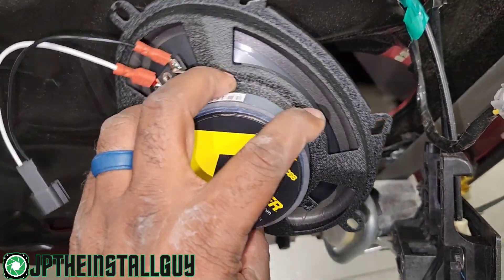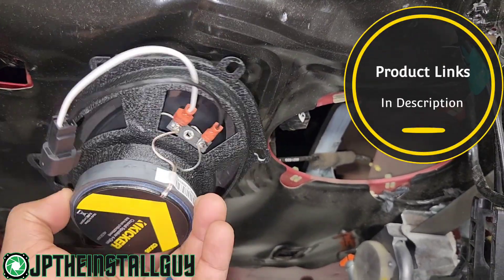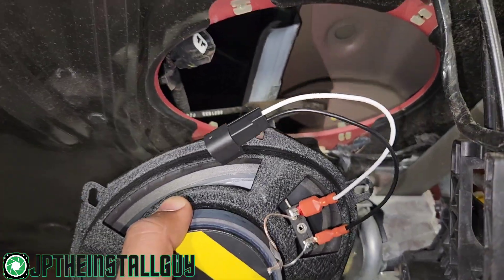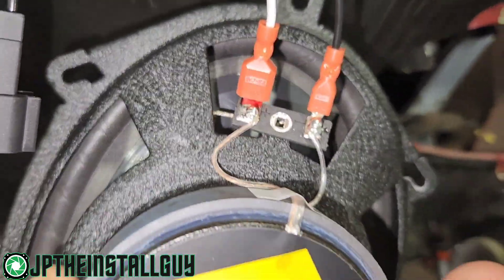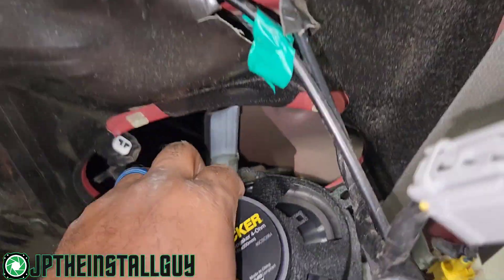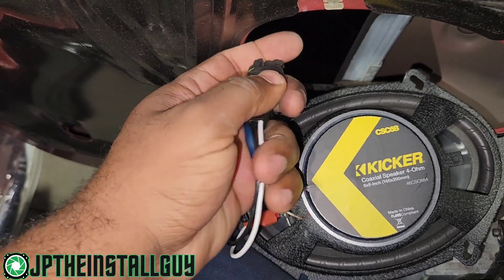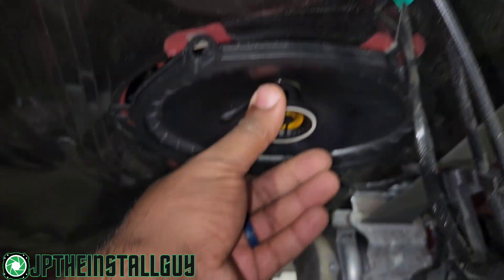What's going to make this speaker install so much easier is we are utilizing the speaker harness. This is the 725600 with the Kicker CS six by eight — we have all the links in the description. The speaker harness makes this plug and play. You have the white for positive with the bigger terminal for the positive side of the speaker, and the black for negative with the smaller terminal. Literally with one hand we just plug these in, then mount our six by eight back in and we are done with this install.